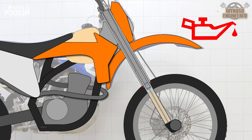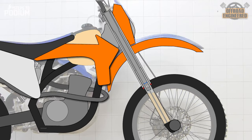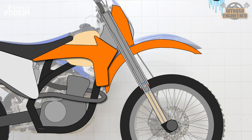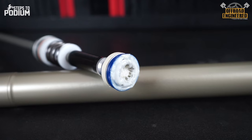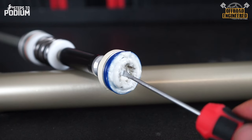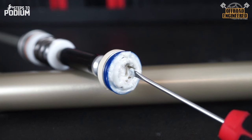As with every closed cartridge, if the cartridge from the damping leg loses its oil pressure, you'll lose all damping performance immediately. Besides that, the air pressure inside a pneumatic cartridge will more easily be affected by temperature variations, so you should check it before every ride. And despite being a simple technology, the pneumatic cartridge requires more frequent maintenance compared to hydraulic cartridges. Even with special grease, nothing beats having everything dipped in oil to reduce wear.